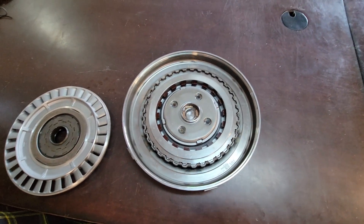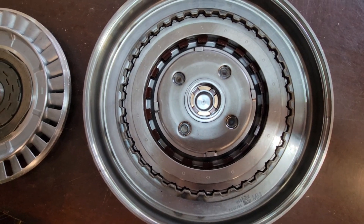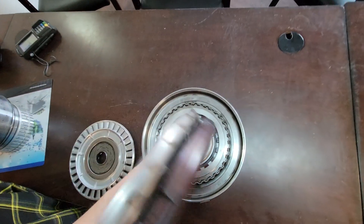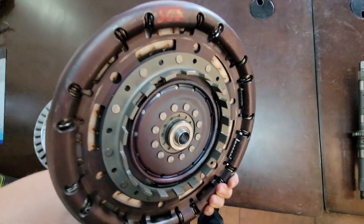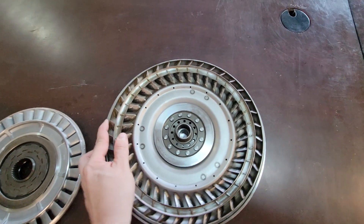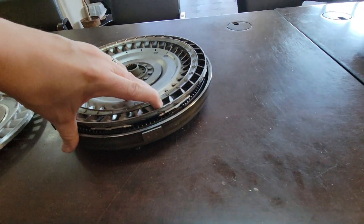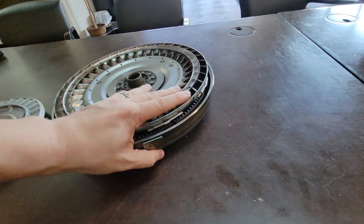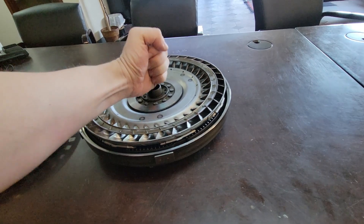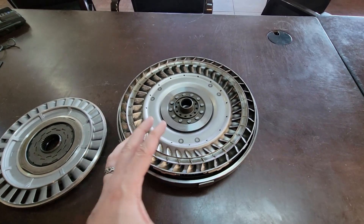I'm not going to put it back together, but I can show you've got two of those clutches — the internal splined ones with the tabs sticking out — and they spline right into that, onto the damper. So when TCC is not applied, they can spin independently. You can see that spins. When you apply pressure through here, that makes it rigid, and then this whole unit will spin with the input shaft. The input shaft splines here makes the rigid connection when those clutches are tight, and that's what lockup is.